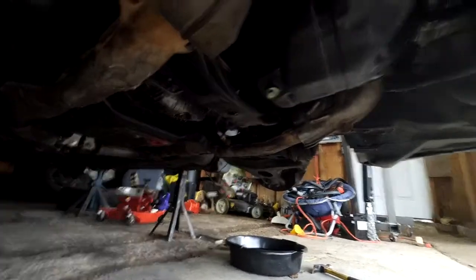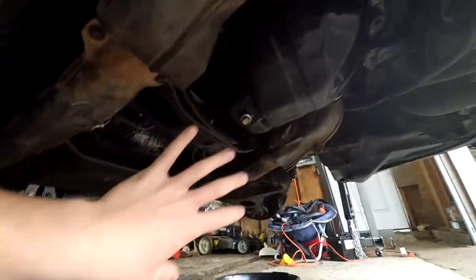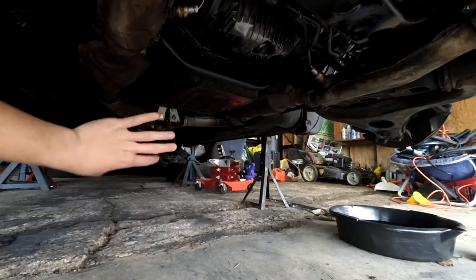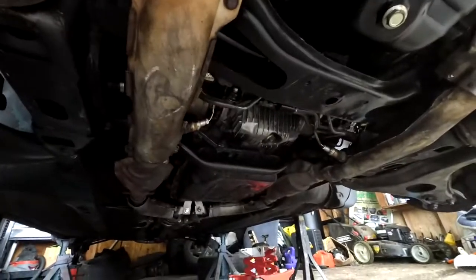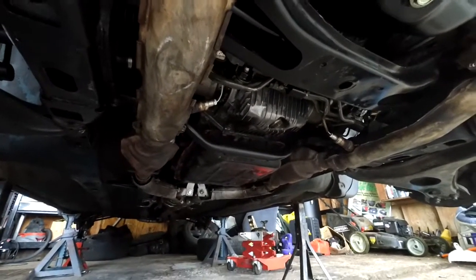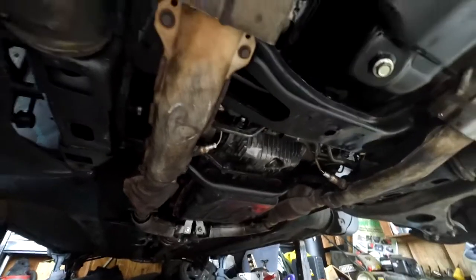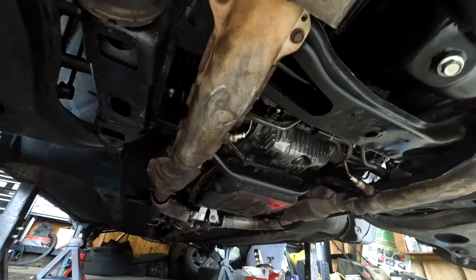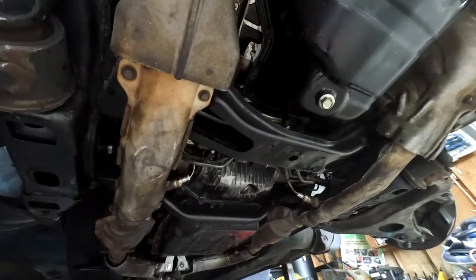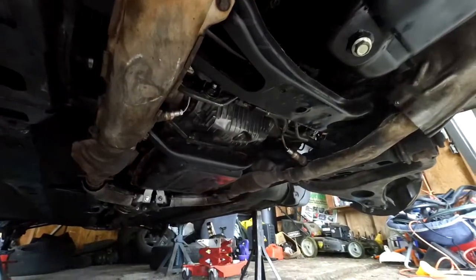Oil pan's done, motor mounts are done, transmission is done. I also replaced the motor mounts — I used Legacy motor mounts because one of the SVX ones was split in half. Again, no idea how many miles are on this transmission. It came out of my friend's '98 Legacy GT, and he had some sketchy Russian dude put it in when he was a kid — literally no idea how many miles, and it was used when he got it. But I'm going to run and get some fluids, put them in this thing, tape off the windshield and stuff, and start painting the hood.